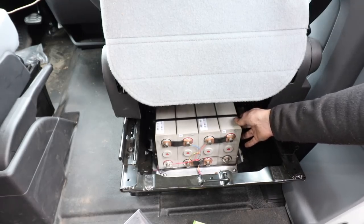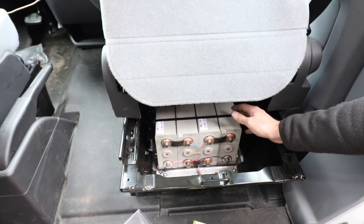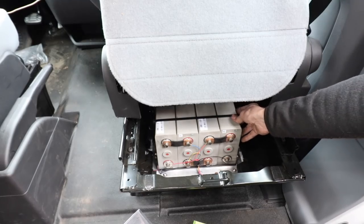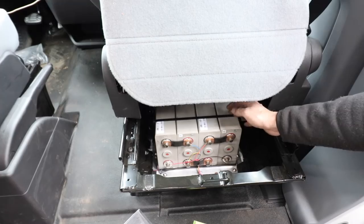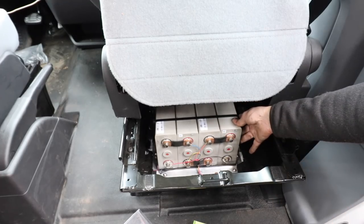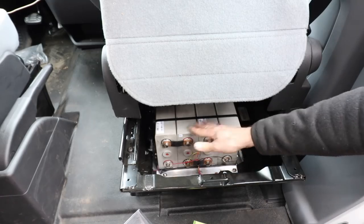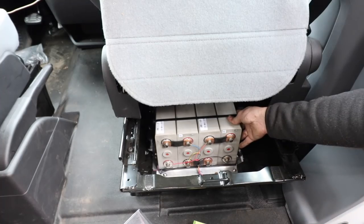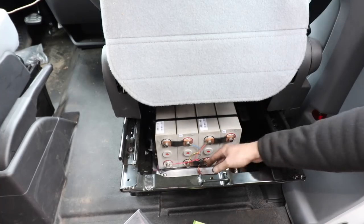The lithium batteries are so far superior to the lead-acid batteries. When you think about lead-acid batteries, that technology is what? Well, they have them in Model Ts - it's time for us to move on. These are more expensive, that's why a lot of people don't put them in, but in the long term they're not. They're a quarter of the weight, roughly. They're a quarter of the size. They charge faster. You're talking four or five thousand cycles charging and discharging versus 400. And you don't have these massive battery banks. They don't vent, so you can put them inside the passenger compartment, and on and on.